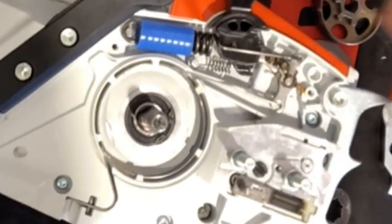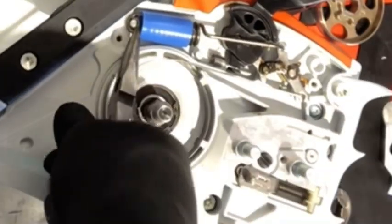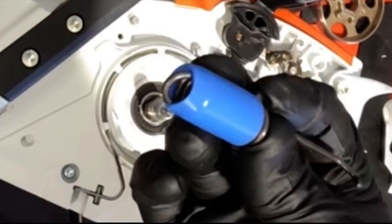Make sure your brake band is off. When your brake is off, you're going to be able to take a pair of needle nose pliers and just pry on the end there and it pops right off. Once you've got that spring out of there, you're going to be able to go ahead and remove the brake band.